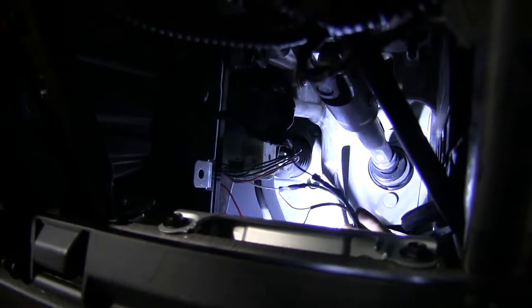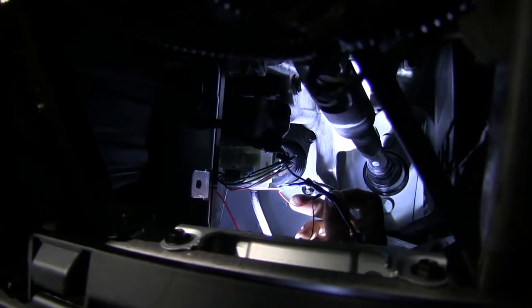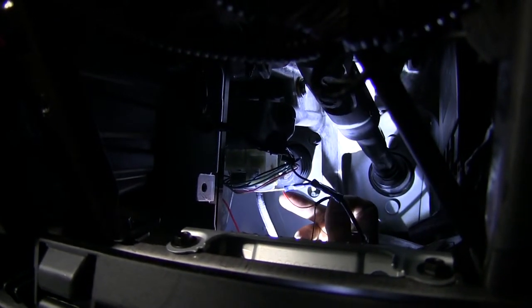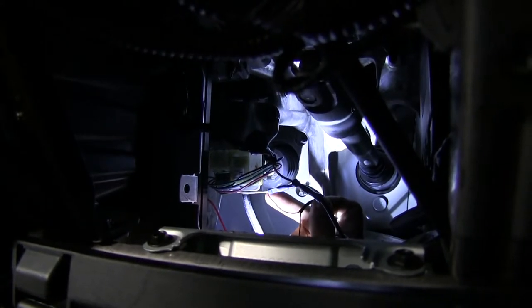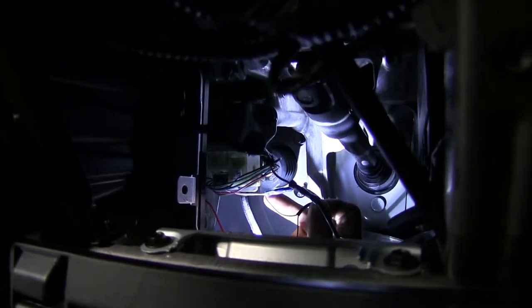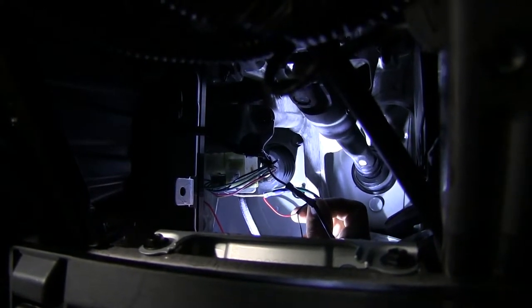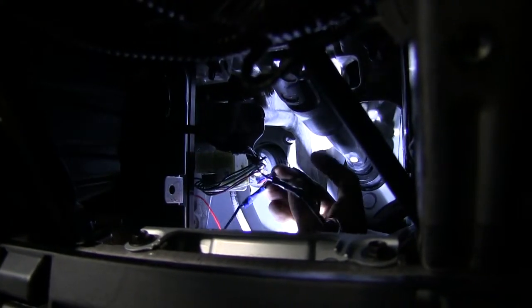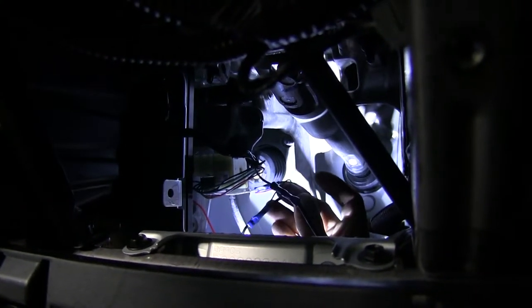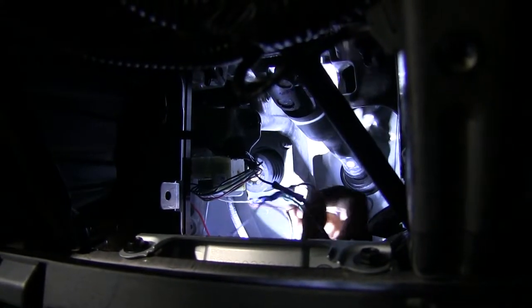With our interior components installed and wired, I'll go ahead and show you where and how we connect them. Our red wire coming from our indicator light, I wired closest to the brake switch — on the cold side of the brake switch wire. That's going to be the wire that only gets power when the brake pedal is depressed. The black wire — I went ahead and got my butt connectors and connected the black wire coming off my indicator light and the black wire coming off my G-Force controller.